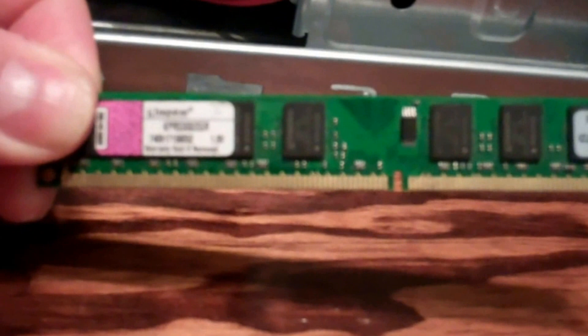While I'm waiting, I might as well go ahead and install the RAM. As you can tell, this is Kingston KPR 5300/2GR - two exact sticks. I'll go ahead and install them and we'll test them when we get the new card installed. That's the old RAM, which are 512 sticks giving it just one gig - PC2 3200, DDR2 400. The four gigs are now installed.